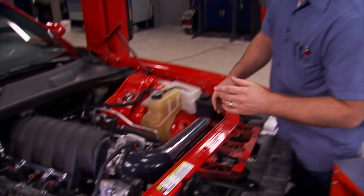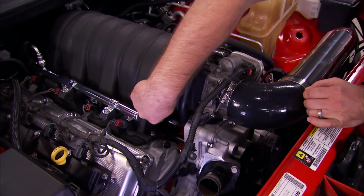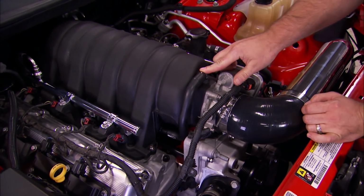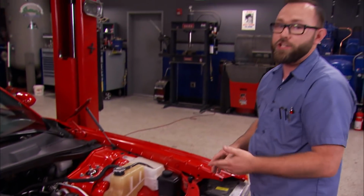Remember earlier we were talking about blow-by. Now one of the side effects of blow-by is positive crankcase pressure. I'm sure you've heard of the PCV system, or positive crankcase ventilation system. How this works is the pressure from the crankcase goes past your PCV valve and it's sent through a hose or tube to the intake manifold. That goes back into your engine to be burnt.